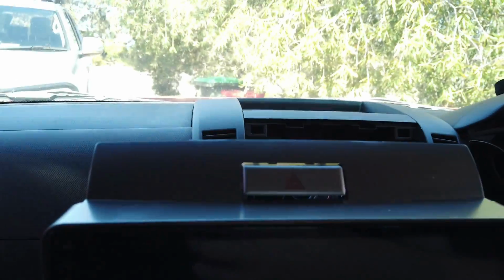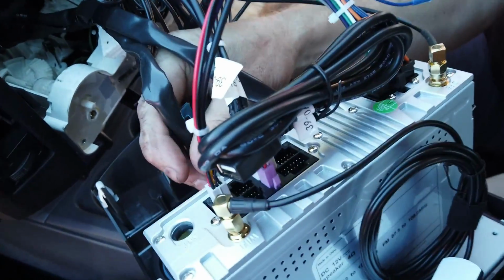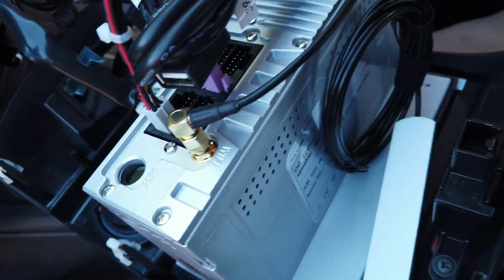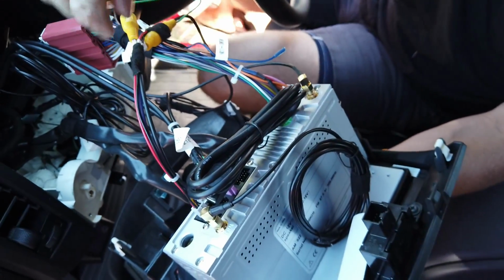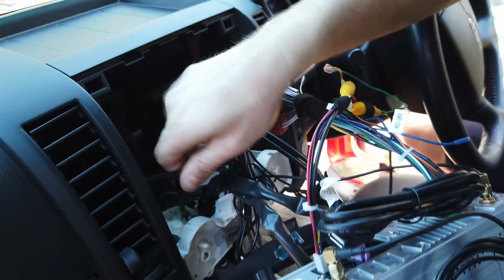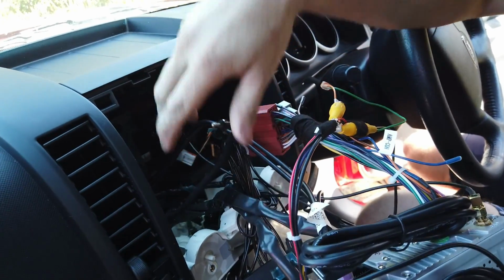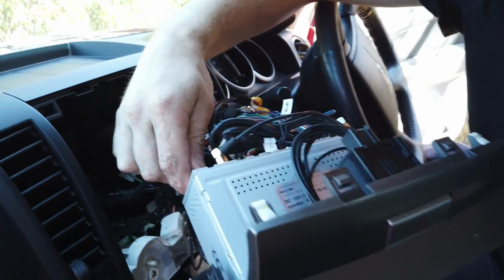So let's see what we got here in the back. You've got your couple of plugs going into the bottom plugs for your aircon. So those are the first two you put in. You've hooked up all your stuff in the back here. So your main 20 pin plug, a reverse camera, second USB you're not using, a Wi-Fi antenna sitting on top, external microphone, FM antenna, don't forget that one. It's under here, we'll pull that back under. We'll plug that in last because it's a little bit short, and then the hazard switch on top. So we'll go through and do all that now.